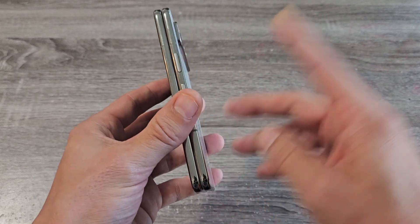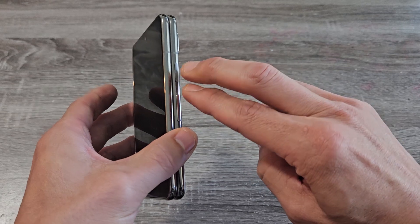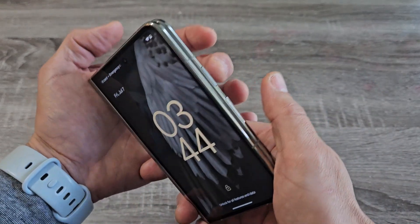How you do that is very simple — it's a two-key combination. You want to press and hold the power button and the volume up, and just keep holding both buttons. So we'll do this together. Let's go ahead and force a restart right now.